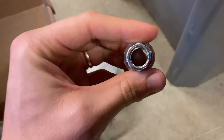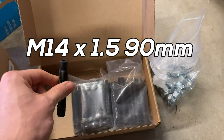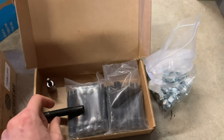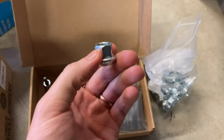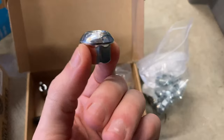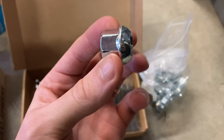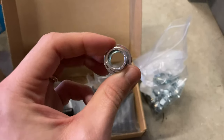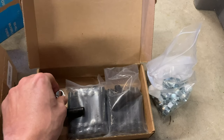So yeah, it's plated. These are M14 by 1.5 — any of the bigger model Mercedes are probably going to be 14mm, and the smaller ones will be M12. These lug nuts are M14 by 1.5, and you want an R14 ball seat if you're using stock wheels — see how it's a ball seat? You have either R12 or R14 depending on whether it's M12 or M14. These are R14s, specified for Audi or Porsche but they'll work on our car. Just double-check that whatever lug nut you're using is no bigger than stock — they'll fit perfectly in the ML55 wheels.